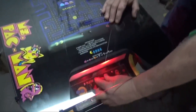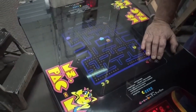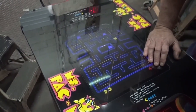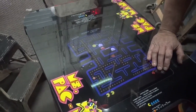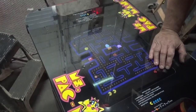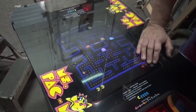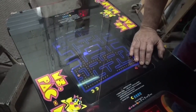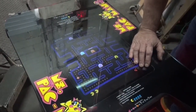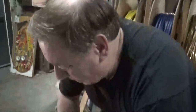Oh, we put in new rubber grommets. You can buy them from the arcade shops. For the joysticks, these are the all-metal Bally joysticks, the best money can buy. The wonderful joysticks are nothing like the horrible micro-switch joysticks that they make today. I always prefer the leaf switch. Whenever we sell a Pac-Man, it always has the original joystick. I'm constantly trying to buy these joysticks. People are taking them out because one switch breaks and putting in these shitty micro-switch joysticks. Did I say shitty? It was a shitty thing to do.